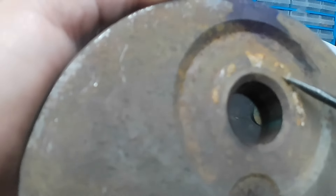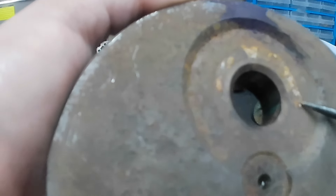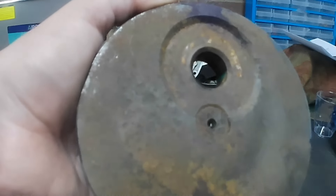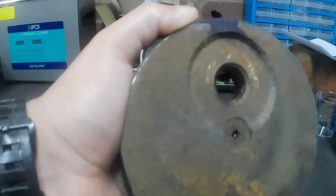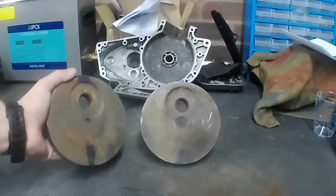On the other side I can't see any wear, although we need to get it cleaned up. We have got bits of big end bearing cage — the aluminium adhering to the steel. We need to get it all cleaned up and buffed and see what kind of surface we've got to work with. That's my next job.